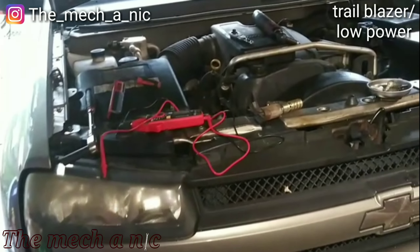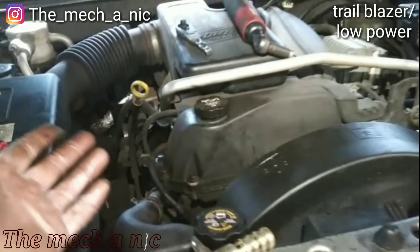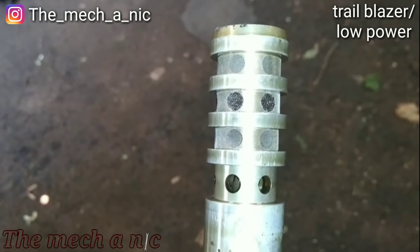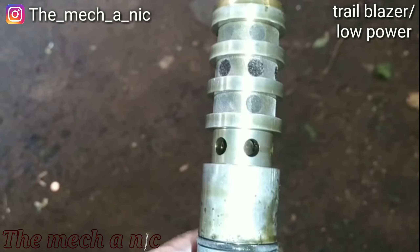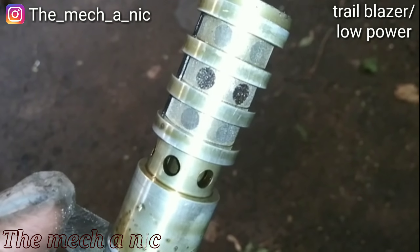Back with that Trailblazer — it's almost never ending. It's got a few other issues, one of them is the P0014. The first thing I want to check is this solenoid right here. I expected to see it clogged because the oil in this engine doesn't get changed very often and it already came out pretty thick and sludgy. Look at the top port and the lower one — they look pretty clean, but look at the center. See how that filter looks like it's clogged?